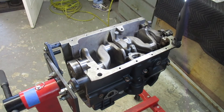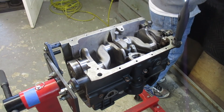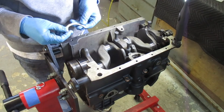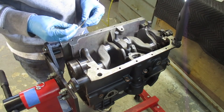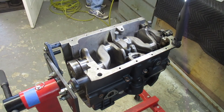The other thing to put in at this time are the thrust washers. What the thrust washers do is prevent the crankshaft from moving forward to aft in the motor when you push the clutch in too far. I got special thrust washers from a gentleman on the web — I'll include the link. He makes them himself; they're solid alloy instead of the clad washers that are original equipment. There are two of them, one front and one back, with oil channels on them so you've got to make sure they go in correctly.